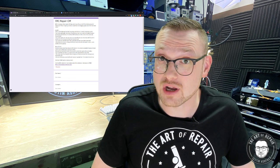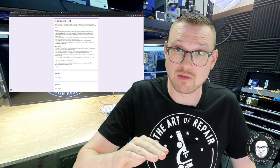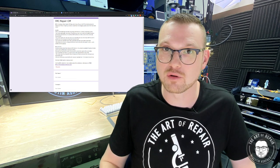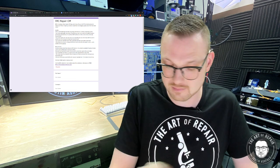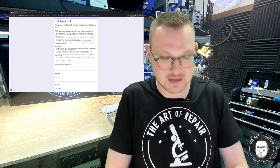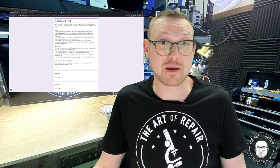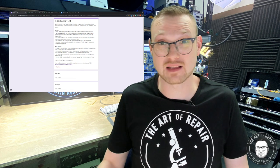I am the official judge of this competition. If I see anybody — a single person — lift up the bottom of the motherboard and flex the motherboard on a phone that already has flexation issues, you will be disqualified. You will not win. There's nothing I can do for you. Don't do that and don't let me catch you doing it. I love you guys, but I'm not going for none of that. Any other way you want to get it out and put it back in as quickly as possible is cool with me, as long as you are not damaging anything. You would be able to use a new port if you want, but I actually think you're probably in a better position to use the one that's already in there so you don't put in something defective and accidentally lose.